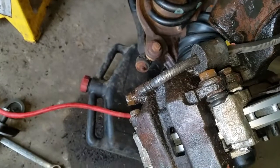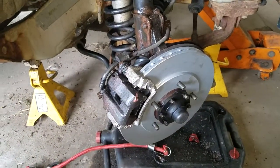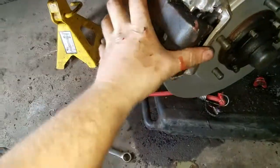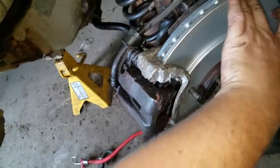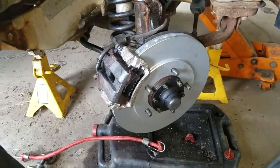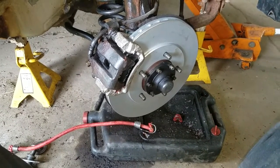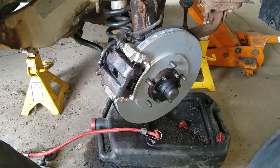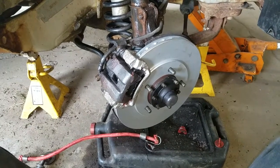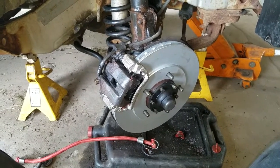Alright, we got that all tightened up. Next what you are going to want to do is put on the cap for your brake fluid reservoir and go and pump the brakes a few times until they get stiff so that the piston can come out and push so you have brakes. Otherwise when you first go to use the brakes you won't have anything to stop. After that all you have to do is put on the tire and you are good to go. I hope this helped you out if you are wondering how to change the brakes and rotor on a 2003 Suzuki Grand Vitara XL7. In the comments below let me know if it helped you out. Hit that like button and subscribe - it helps us out. I will see you guys later.